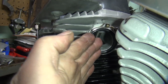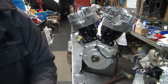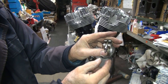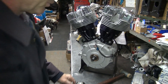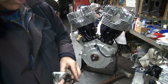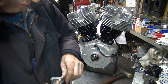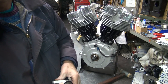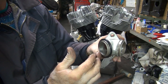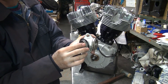So now I can just slip the manifold in here and then rotate it and slide it in. If that's too tight it won't let me do that — I'll have to loosen up just a little bit. Then I've got to put this clamp up in there, get it engaged, pull it together, and put the nut on it while holding everything else together. The easy way to do the O-ring is you take it and wrap it around the manifold right now, just by rolling it. Slip this side in, let go of this, it'll roll down and pop in there — and you don't cut the O-ring because the manifold is already in where it belongs.